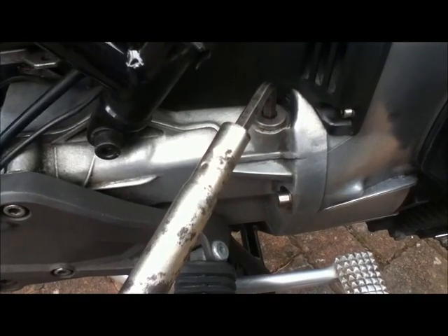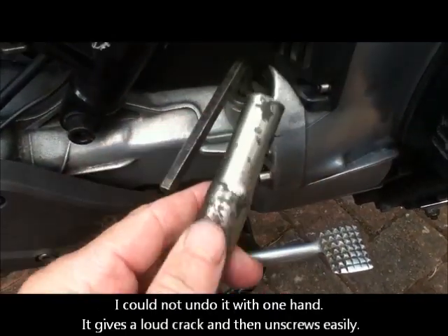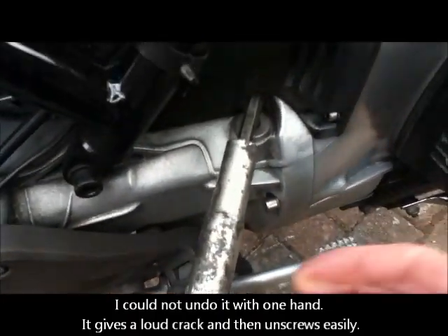There's a 10mm dip - that should be the level, so I can use that as my dipstick. The nice thing about it is it's got a serrated edge that will hold the oil on it when I pull it out. I'll take the gearbox plug out using the allen key that came off the bike with the wheel wrench extension, because this is going to be really stiff.